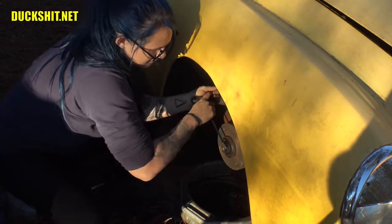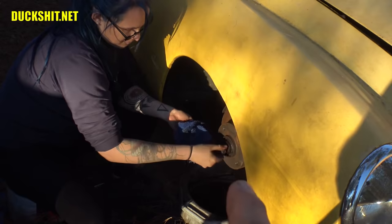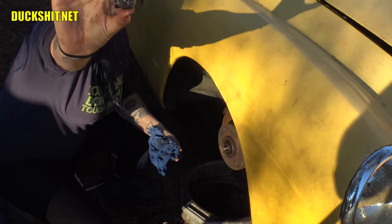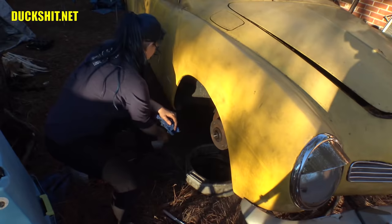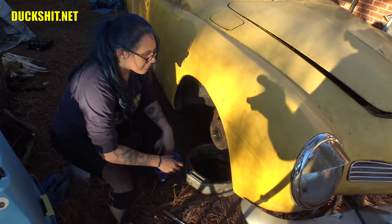The reason why she did that backwards, guys, is because before we started this video, we actually tested everything to make sure we got set up for it so she understood the process. And we did it on the opposite side, which is a reverse threaded nut. This side is a standard threaded nut. And the only reverse threaded nut on the whole Volkswagen, if I'm not mistaken, and I'm pretty sure I'm right, is on the left front spindle. And that's the one you learned on first. A little lower. There it is. That one is exactly like it, just threaded differently. But it's pretty simple how it operates. Because it's left-hand threaded, the wheel, of course, turns leftwards while you're driving forwards. You don't want the wheel to unscrew the nut. So that was the theory behind it anyway.